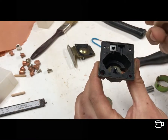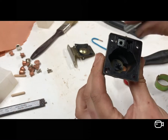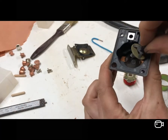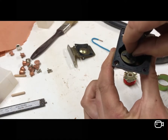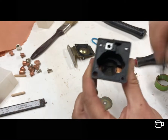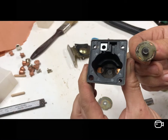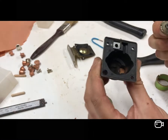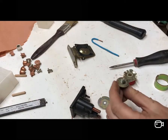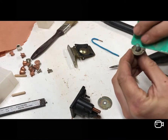This is the top of the plunger - again charred and blackened. What happens is it sits in there, and as the coil is powered it sends the plunger up so it pushes the copper plate onto the two copper terminals to complete the circuit. Then you take away the ignition 12 volt and it opens. Typical of anything that's got switching contacts - they've charred up and burnt. So all I need to do is take some sandpaper and clean off these contacts.